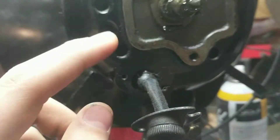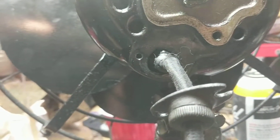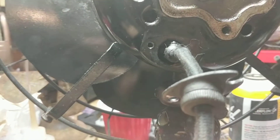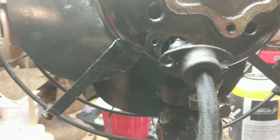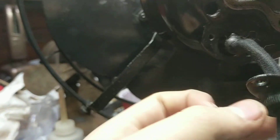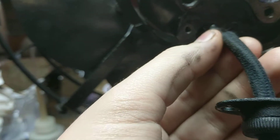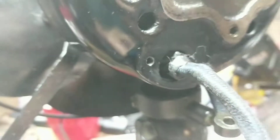There are lead wires — do not pull the lead wires out. You have to be very careful. If you know how it's wired up with a multimeter, you can cut the wire here and I can send you a picture of how these are supposed to be wired. If you don't, make sure you figure out which wire goes where before you cut anything or you'll mess it up. Do not pull any lead wires out — they're probably dry rotted and you could pull out the leads from the motor.